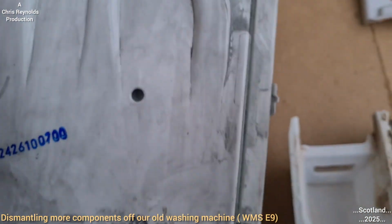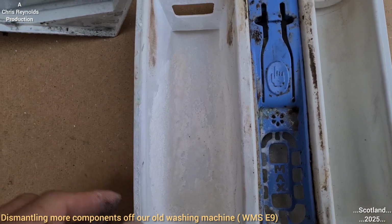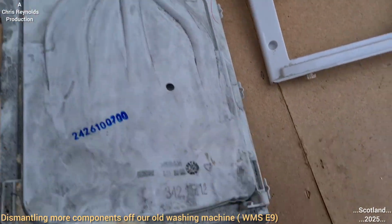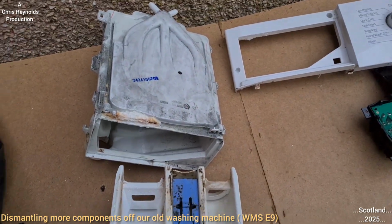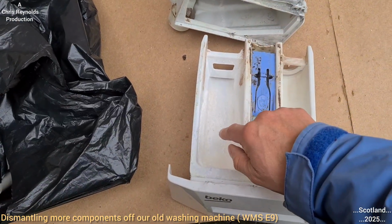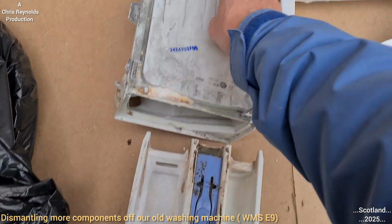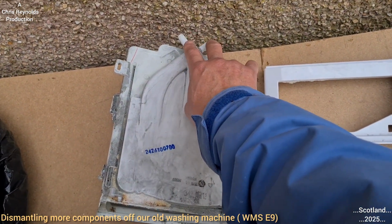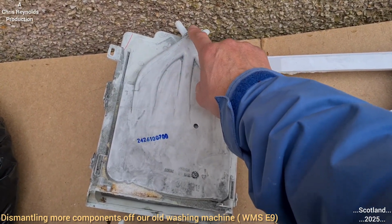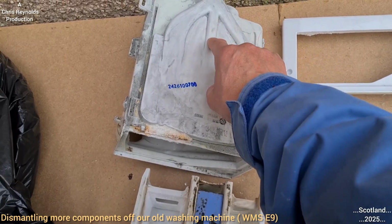What puzzled me is how the water actually got into the centre to wash the softener into the drum. I know that the channels on the top here, water comes in from there and it will go into the pre-wash, and for the main wash the water will come in through the hose, wash the main wash powder in there. But to get the softener, what I reckon is that both valves opened and you had water coming in there, water coming in there, which when they met, the water would collide and then eventually escape along here.